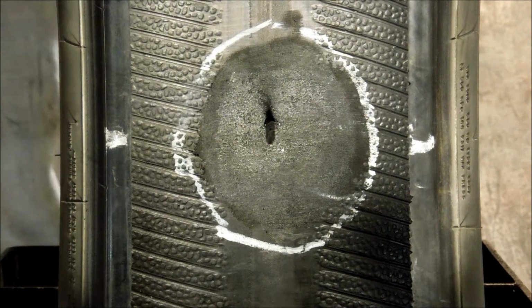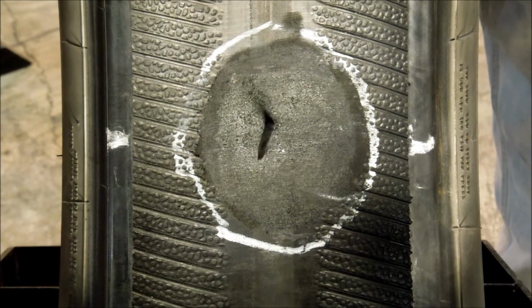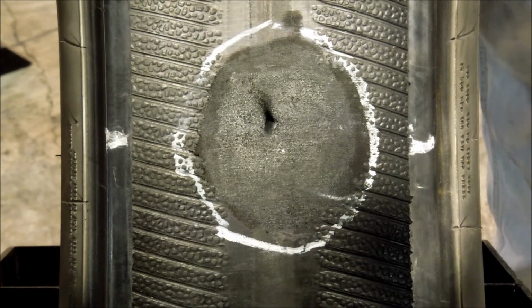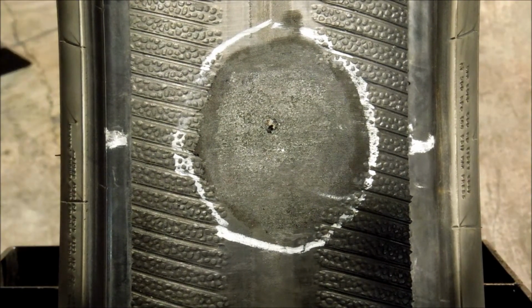Relax the tire so the beads are not spread. Remove the spiral tool. For easy handling, apply a small amount of chemical vulcanizing cement to the black, tapered portion of the stem.